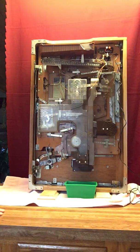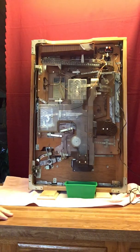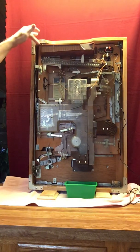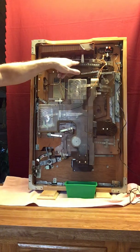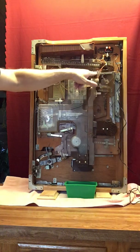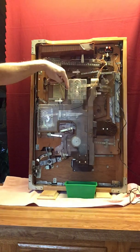And you want to put about 95% of the balls that you bought for the machine in the upper hopper, or until it's full. It will support the weight. It's got plenty of screws in it to support the weight. So again, the balls queue up into a double row. They go into the turnaround, come down here, and then they'll go on either side of the jackpot chamber.